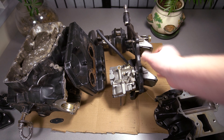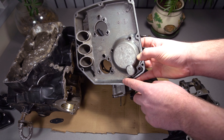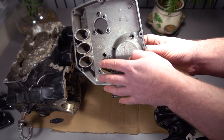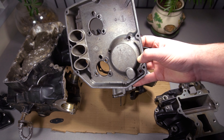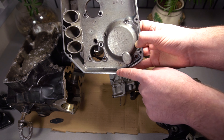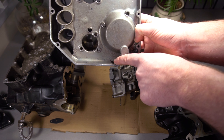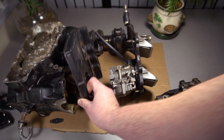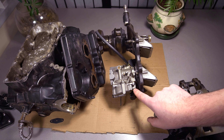All this is is a fuel safety hose. It's at the very bottom of the air box, and if any gas happens to just fall out of the carburetors or spit out for any reason whatsoever, instead of just draining in here and accumulating or eventually dripping down into your working motor, it collects in this tiny little hole here which gets taken through a hose to the main block.